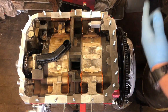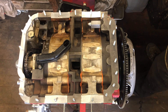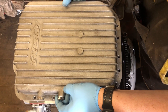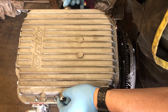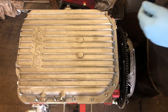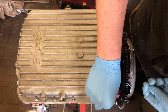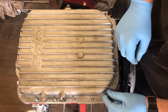We've let the studs set and we've also cleaned up the oil pan and installed all the hardware. Next, all we need to do is offer the oil pan up — at this point we've also applied a bit of sealant around the oil pan itself — drop it over the studs and allow it to sit in place. Once that's done, we'll take the stainless steel 10mm nuts and screw them all down into place.